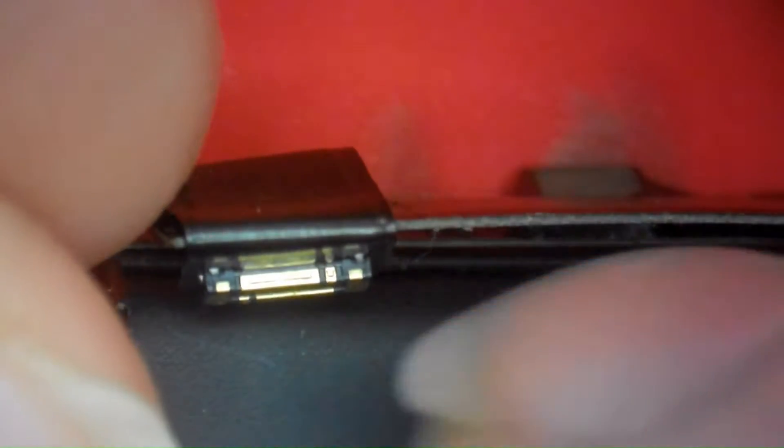The metal back plate of the tag-on sits up against the cell and everything aligns parallel to the OEM flex. The tag-on flex runs up against and behind the cell, and the original FPC connector that we folded back plugs directly into the tag-on. Once plugged in and hidden behind, the tag-on flex sits in between the cell and the OEM flex. We fold over the FPC from the tag-on — this is what connects to the logic board, now in the original orientation the OEM FPC was in.